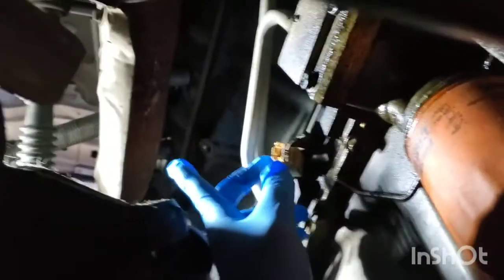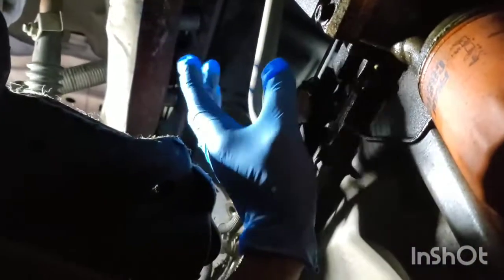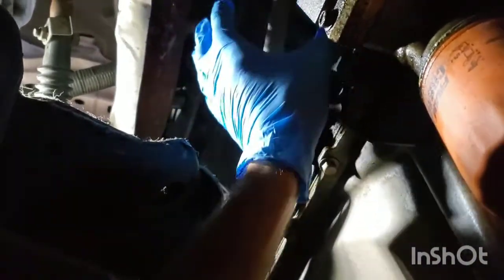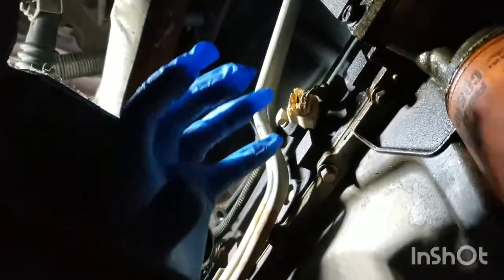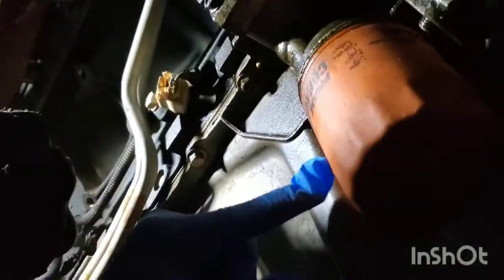If you come underneath back behind the cross member, then you can finagle the engine mount around the exhaust and bring it up and over and right by the sensor, and then bring it right down through here by the oil filter, and then you can come out forward between where the engine mounts to and the frame, and it'll fall right out right there.